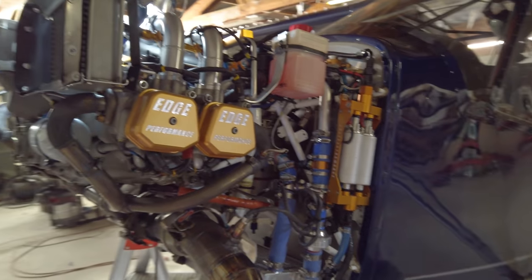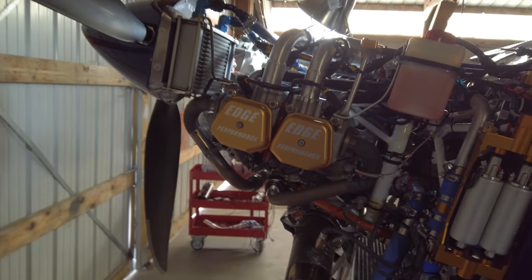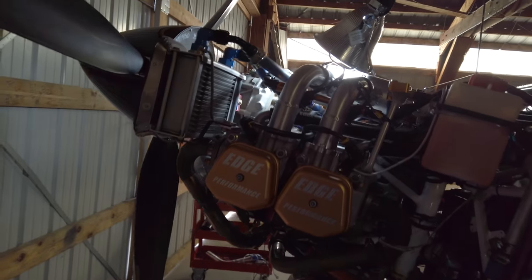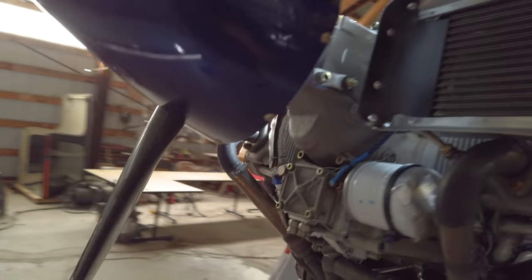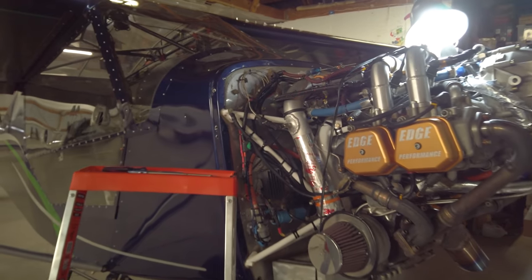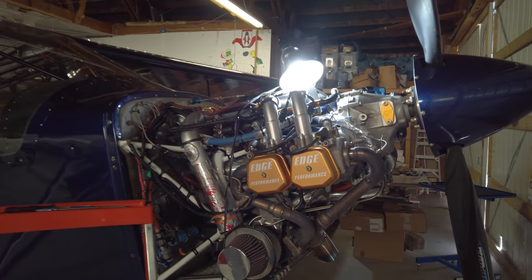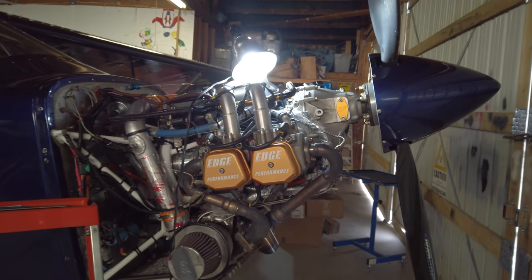The airplane was finished in beginning of '17 or end of '16, but the engine is older, and it's not a through-bolt case, not a heavy case. And these older cases had trouble even at stock power. And I hadn't really turned it up much. You know, the exhaust setup I made for it made a little bit more power. And then the fuel injection setup, I had tuned it to just make a little bit more power. Between those two mods, I picked up somewhere in the neighborhood of maybe 200 RPM. But I hadn't cranked it way up or anything.